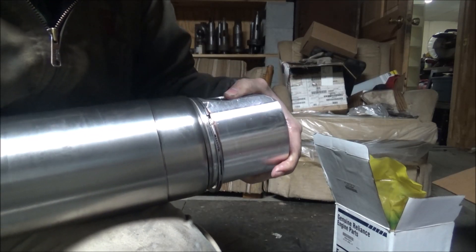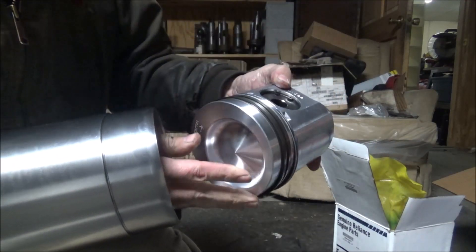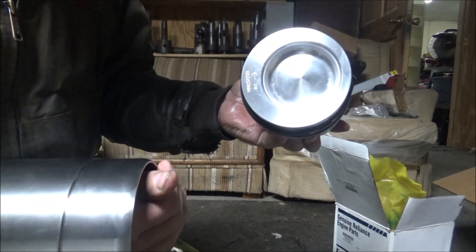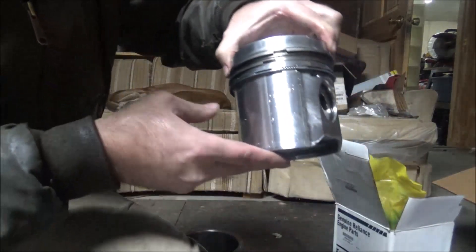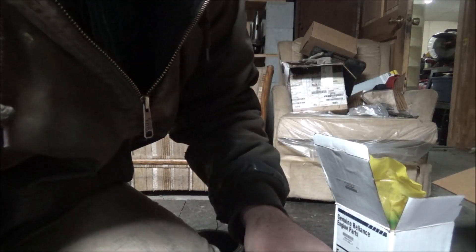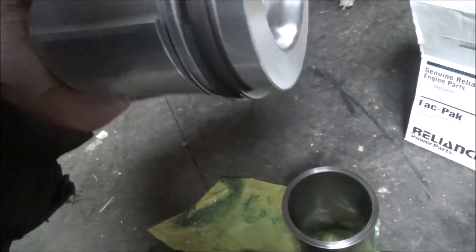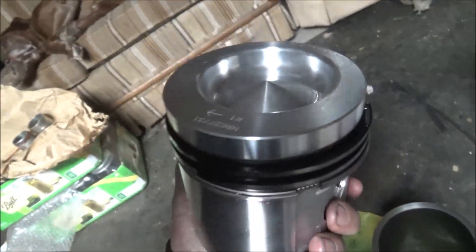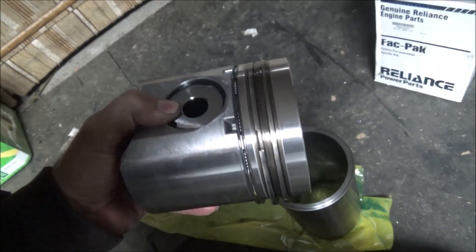I'm going to push this out and you'll see what's going on. Here's the gap in the piston ring. That one there is staggered. That's what the one before it looked like. All right, there's another one. It looks like two out of six of them were staggered. The only one I got the camera for comes out right. But just telling you that you should probably check these to see if they are indeed staggered, because some of them were not.